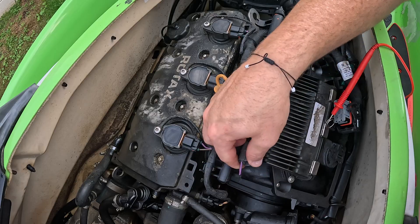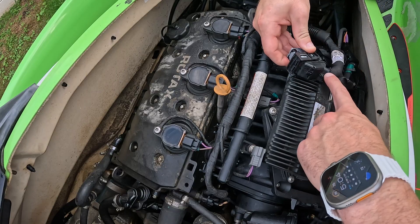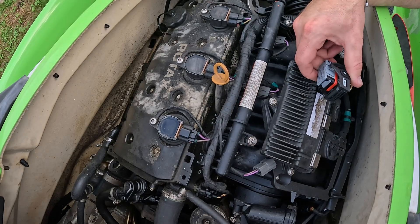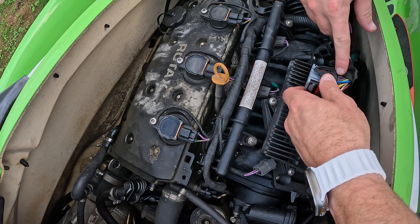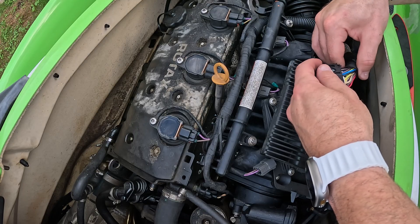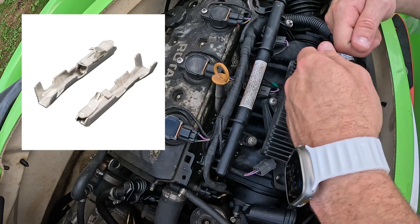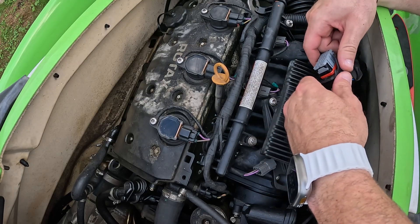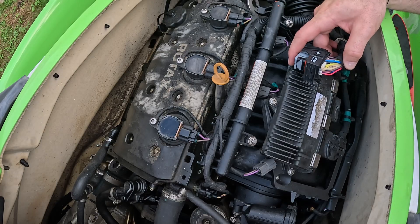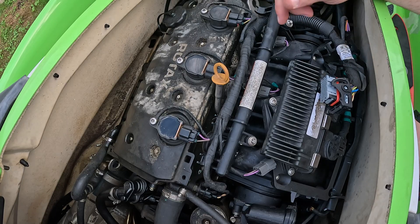The service actions didn't indicate what the second wire is, so I pulled off the backside of the wire harness and matched it up by color. I traced it down to port K1, and on the backside it was actually not pressed in all the way. The wires are crimped with a little metal crimp and then pushed into the plastic harness to snap into place — that one was not in all the way. I pushed it back in, replaced the cover on the harness, and now we'll restart the ski, connect to Buds, and see if that fixed the issue.